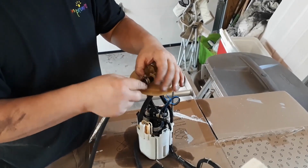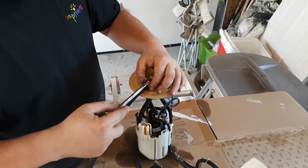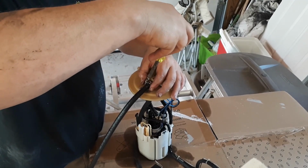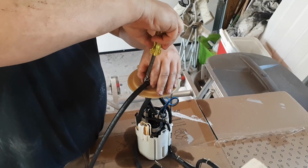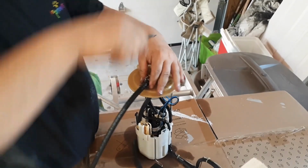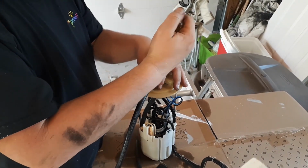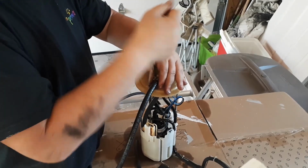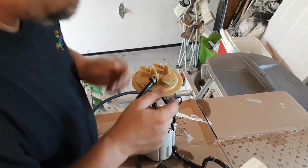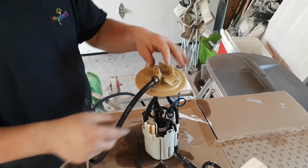Run up this hose clamp a bit, or get it squeezed over that ridge. Get it tightened down. This isn't a pressure line, so you don't really have to worry about it blowing off or blowing out a leak. It's the vacuum on this, and the heater's not drawing a whole lot of fuel. It's pretty minimal, so that's on there good and tight.